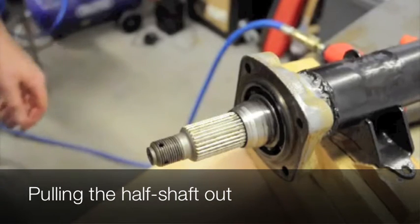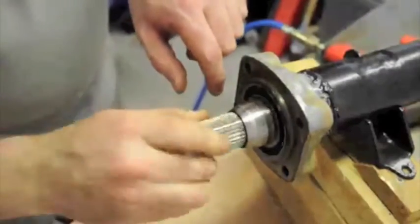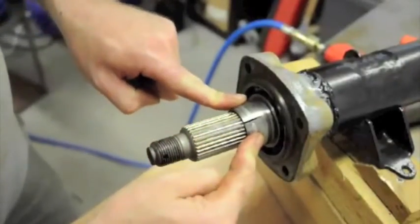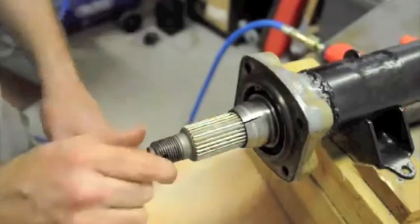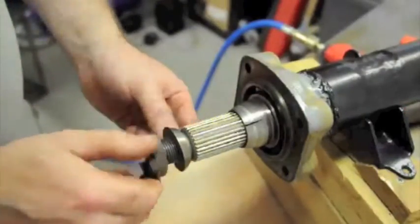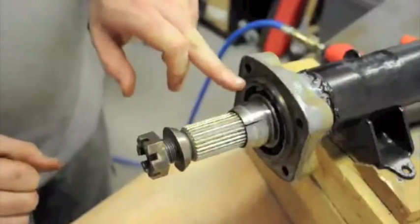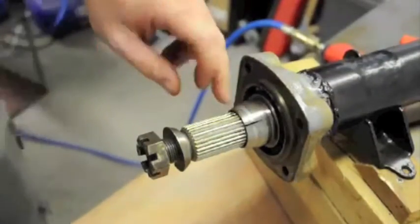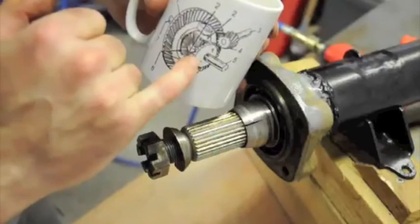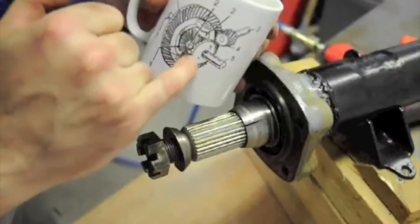So I've repositioned the camera slightly so that hopefully you can see a little bit better what I'm doing here. Here's the bearing, which seems to be moving nice and smoothly without any binding. Here is the collar that I may want to remove. These are the splines that the hub sits on, and this is the end that the castle nut and this collar sit on. So what I want to do is pull this half shaft out of the axle so that I can inspect the bearings, replace this collar if I need to, and at the other end of the half shaft, I don't know if you can see, this is my engineering mug, is a gear inside the differential, and there's the half shaft there, and I want to take that gear out so that the